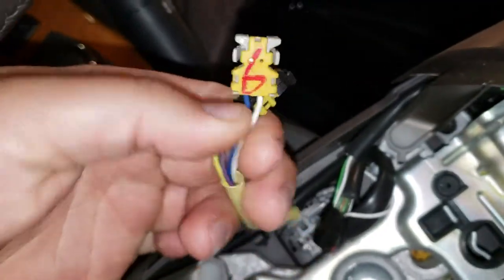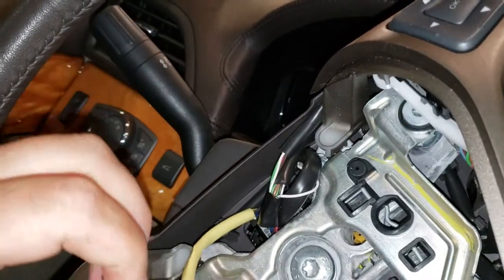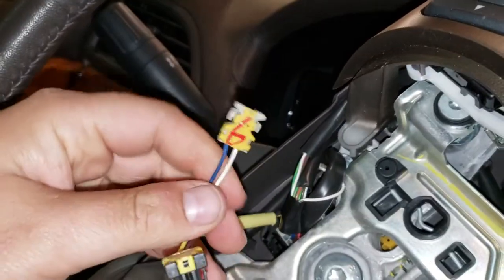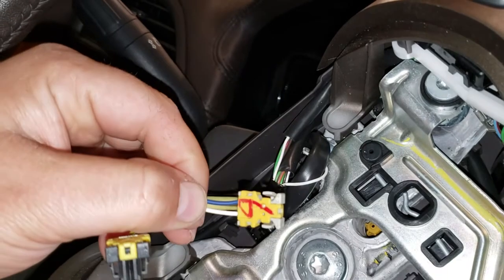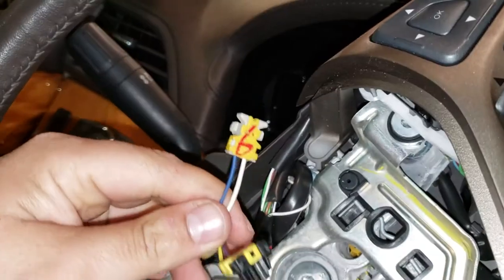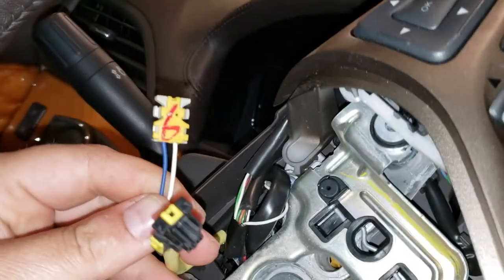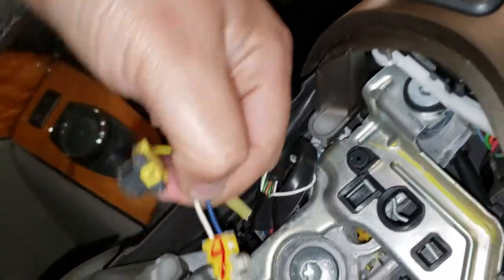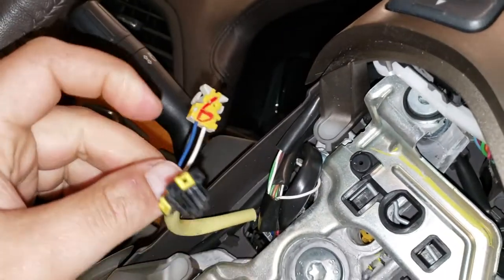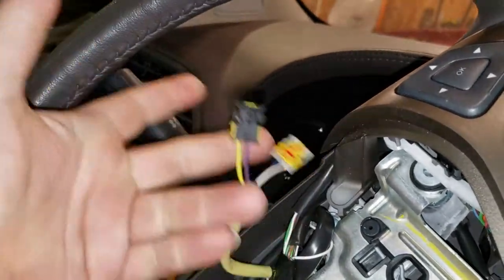You've got tab one, two, and three on the other side. Once you take those off, make sure you notate which wire goes where. For example, on this connector — if you're staring at it with this orientation, the left wire is blue and the right wire is white. If you flip it the other way it's reversed. So make sure you put the wires in the right order on both connectors.